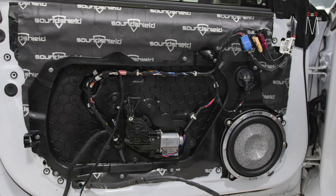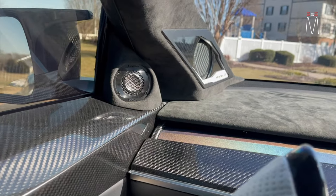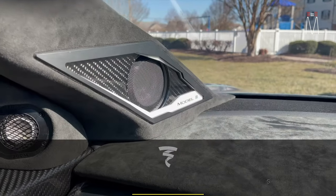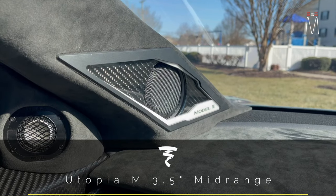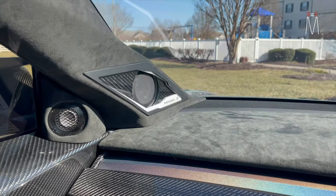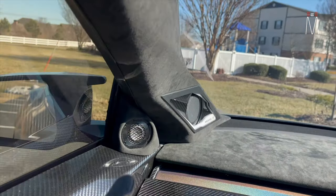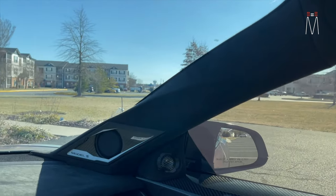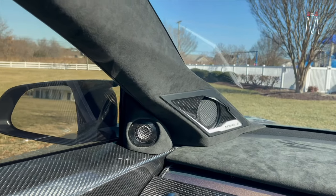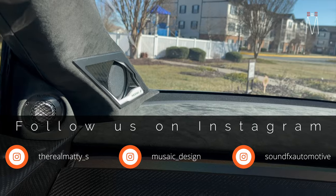There's Black Hole tile on the inner part of the door skin to eliminate back-wave reflections from the lower mid-bass air and add mass to the door panel, creating a better acoustic environment. For tweeters, we use the Focal Utopia M tweeters — you can see those in these custom sail panels. We have the Focal Utopia M mid-range 3.5-inch in these custom pillars. All these components were made specifically for this application. We included carbon fiber — 20-ounce carbon fiber hand-laid. We designed the grille and the A-pillar, which has a body line that rides right down the pillar, making that hard shape look more organic.